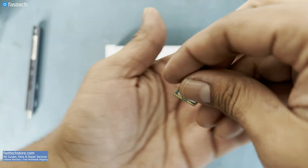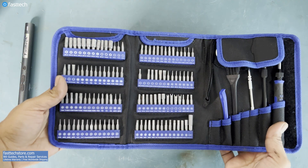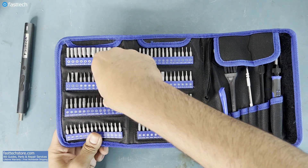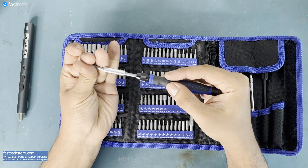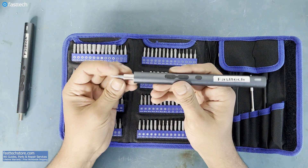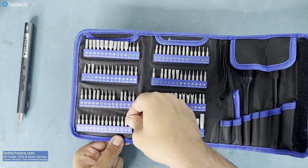Now, to get to this chip, we need to partially disassemble the Wii. We're going to need a FastTechPro toolkit — links in the description box and pinned comment. We're going to grab a Y bit, which is this bit right here. We can choose to hand-turn screws or, if you're a boss like myself, you can grab a FastTechProAuto kit, which is an automatic screwdriver that will save you a lot of time. We're also going to grab this metal pry tool and a Phillips bit.